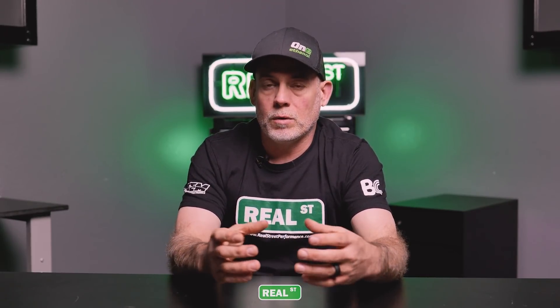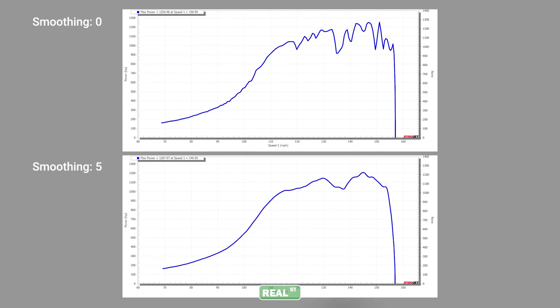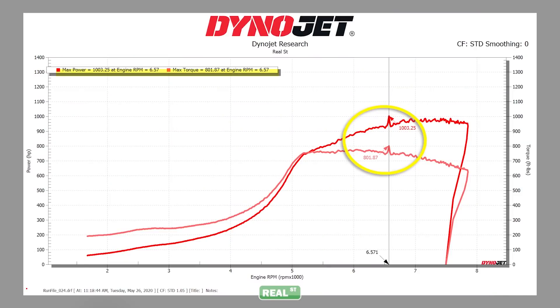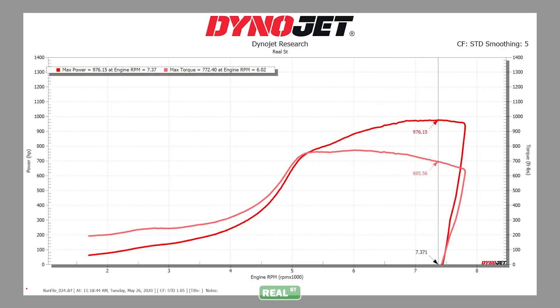This brings us to our next concern: sampling or smoothing. Most dynos have a filtering rate, and you can look at a sheet with zero filtering or with filtering on — it takes a capture or average of the drum samples and applies them to the graph as a filter. You can see the difference between zero filter and a filter of five. I prefer showing runs with zero filtering because it's a better illustration of how the engine is actually running. The last thing to note on Dynojet runs: if you hit the rev limiter or experience wheel spin that suddenly stops, you'll see blips in the graph that show up in the peak power number but aren't real — they can be changed with filtering. Always look at the graph as a whole; if anything looks irregular, chances are it didn't happen or you have a problem. The dyno graph should look smooth and consistent with how the engine sounds and runs.